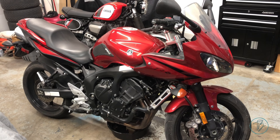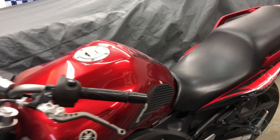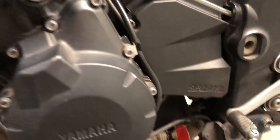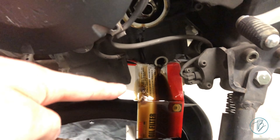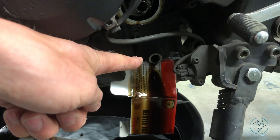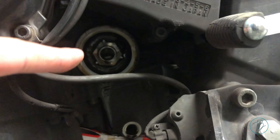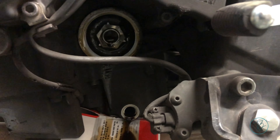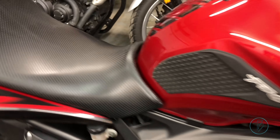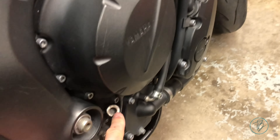Here's a close-up of it. Real nice bike. Just in the middle of doing the oil change — super simple on this bike. Down here I put a piece of cardboard to cover the exhaust so oil wouldn't drip on it. The drain plug is right there and the oil filter is right above it. Spin both off, drain it. The fill is on the other side — that's your fill, and your dipstick is right down here.